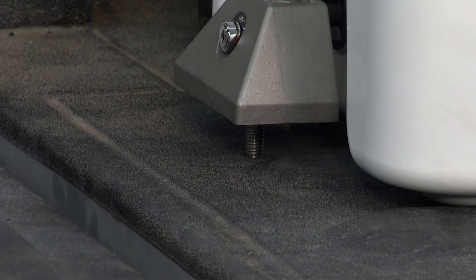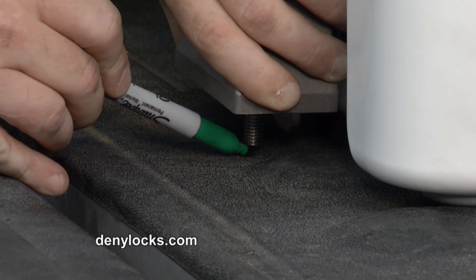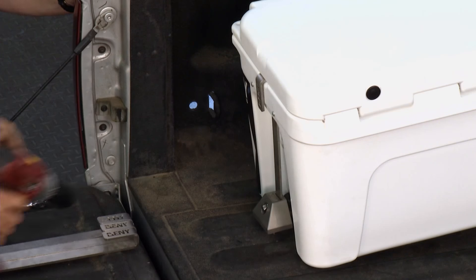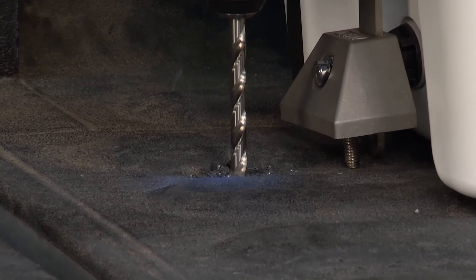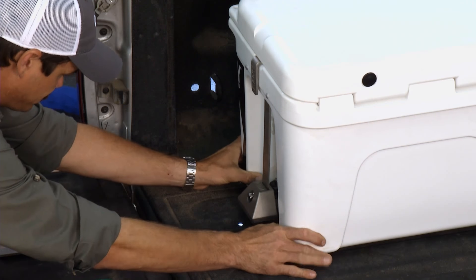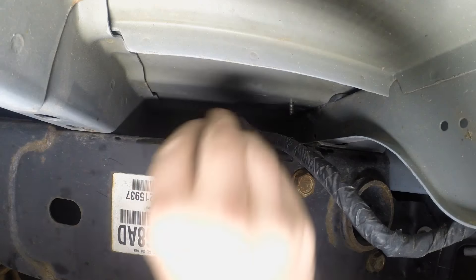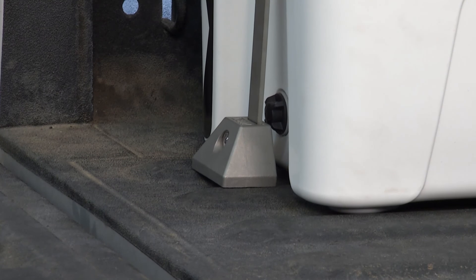In general, you just want to set it up — pop this up here and I'll show you. This enables you to see where you're going to set it. Since you're drilling a hole, you want to make sure it's in the right spot. Move it back a little bit and mark the hole first, so we're going to have our stud right there, then lift it up and make our mark. Use a 3/8ths drill bit. So once you drill the hole, you slide it forward and it'll slide directly in. Push the button, and the cooler helps hold it down so it doesn't turn around in a circle.